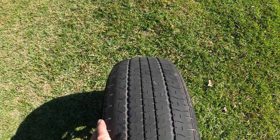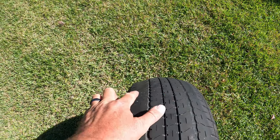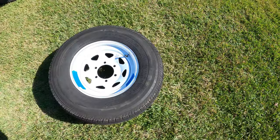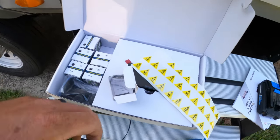Hey — something I noticed: look at this tire right here. It doesn't look too bad, but when you roll it around a little ways — look at that — a radial belt snapped in that tire. Definitely time to get these changed. I've got them all labeled with numbers because I need to make sure the guys at the tire shop put the right sensor in the right tire.